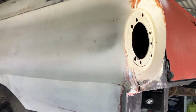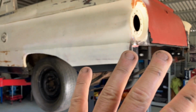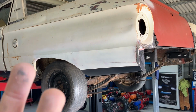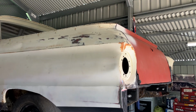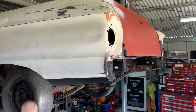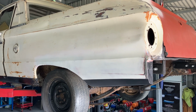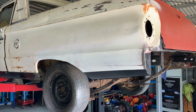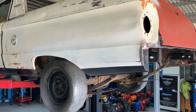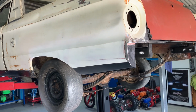Now, it's not a perfect match, you can see that, but I'm tipping by the time I rub that back and bring some of the black and red out to get a similar effect to up there and on the tailgate and all that, it's going to be pretty close. To match that colour is going to be damn hard. So as long as it's pretty close, and with, as I say, rub through in spots, that'll tend to hopefully take attention away from a poor match.